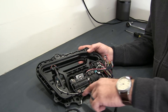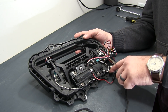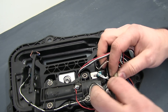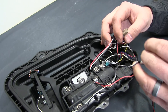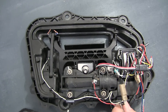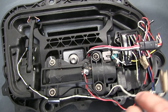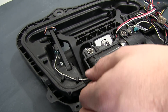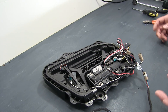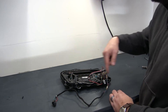The third option is to get a complete replacement harness from Tesla, which includes the micro switch, all the wiring, and the second micro switch, connecting to a handy plug that makes it easily replaceable. This whole assembly is about 30 or 35 dollars from Tesla, and with a flexible torx driver you can just unscrew it, replace it, slide it back into the slots. Once replaced, the handle should retract without any further work other than resealing it.